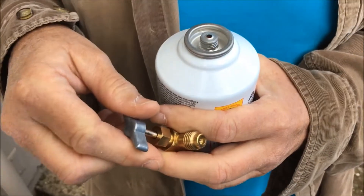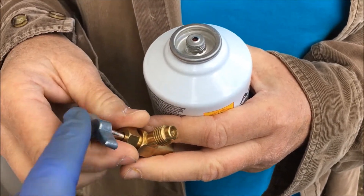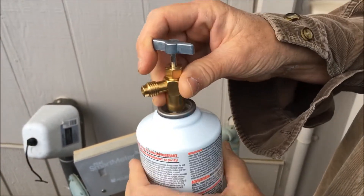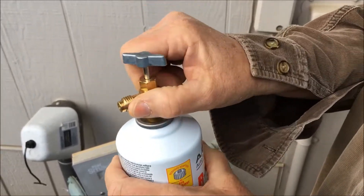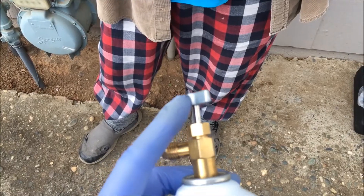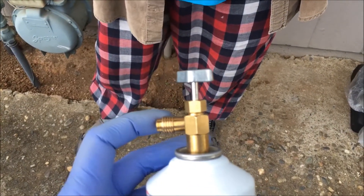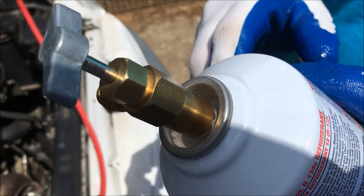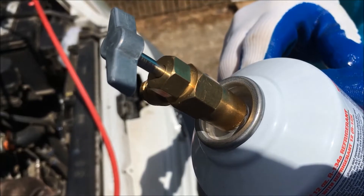Sister's going to show you how to put the tap on the can. It's in the fully open position, which means the handle is turned all the way counterclockwise. You want to make sure that handle remains in the fully open position until you're ready to have that refrigerant flow and your supply line is on. Before you put that tap on, you're going to look at the seal on the bottom of it — make sure that seal is good or it will not hold the refrigerant when it comes out of the can.